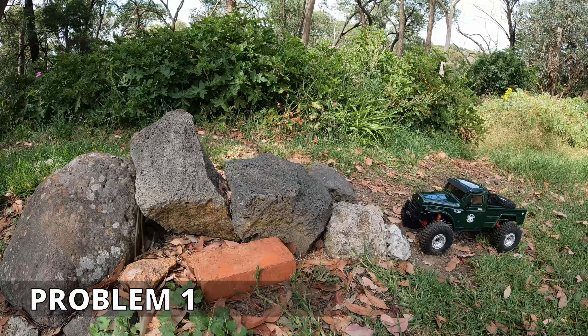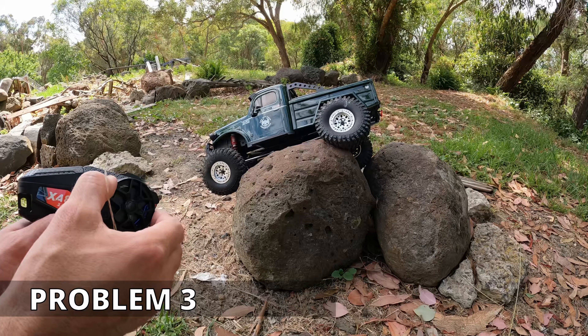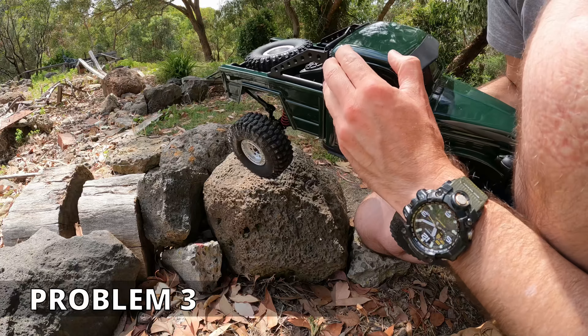Some of these brass upgrades where you get brass spacers, brass bumper mounts, brass battery trays — anything that puts brass up on the chassis — that's bad. You don't want that because it increases your suspended mass. We've got DIG and it just squatted down like that. It's a nice strong servo — I didn't expect it to be this good. We've popped out of DIG now. I'm going to gently reverse and listen for the click. I'm having trouble getting it out of DIG. There was a click. That's what I was waiting for. Although it did it cleanly, I'd like to see it disengage more readily.